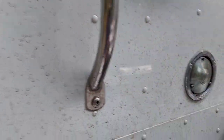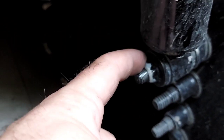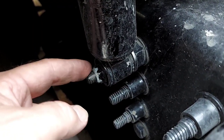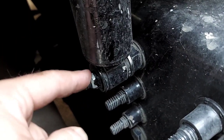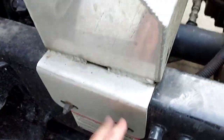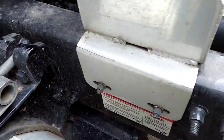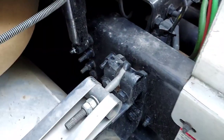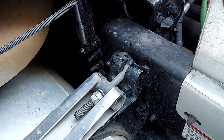The ground is going to come down the grab bar and then I'm going to go right here to this shock bolt. I already cleaned this off a little bit to make sure we have good ground. I'm going to take this bolt out, clean the paint off the nut, off the washer, and off the bolt itself so we get a good ground. We're going to have one on this side and one over on the other side. There's not a lot of option right here to go to the frame except for this bolt right here, and the connectors I showed you will get them to work on those bolts.